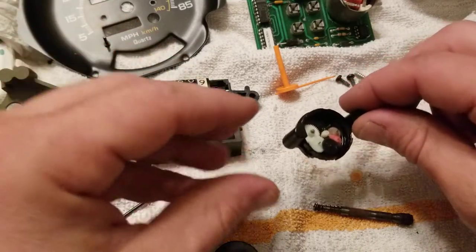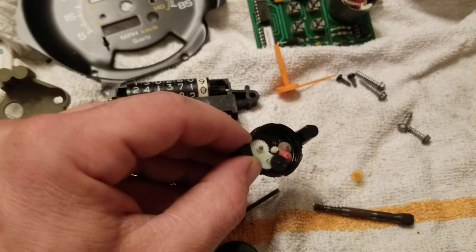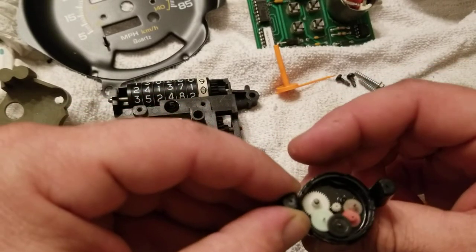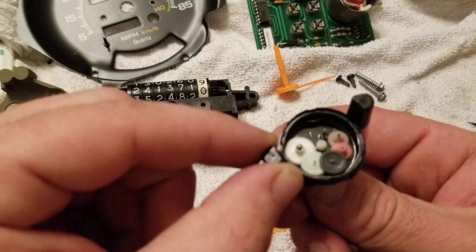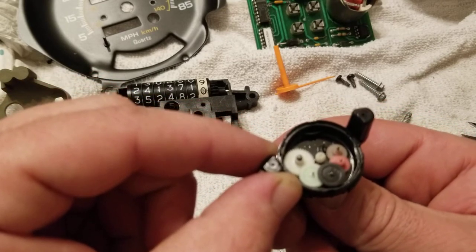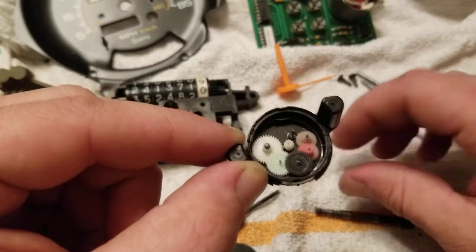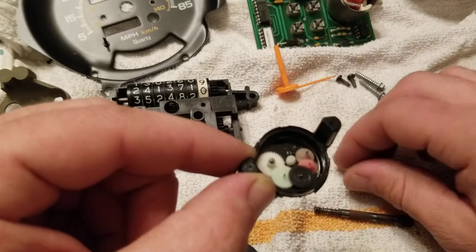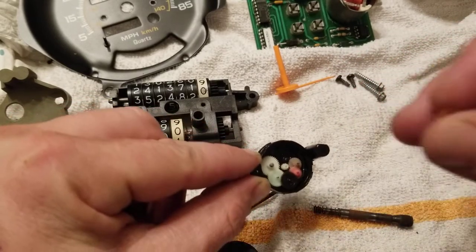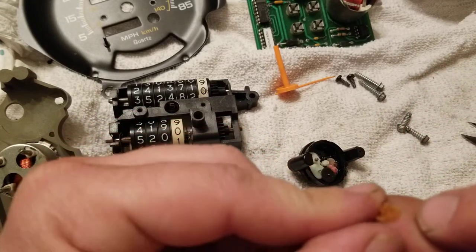So I took my cutters and after spinning all this and realizing it's not great to spin the output on such a large gear reduction — it's really hard on the gears — I was spinning it to diagnose the problem. If you carefully touch it, it would grab and work for a second because the motor was spinning it between the broken teeth, but yeah, it didn't work.